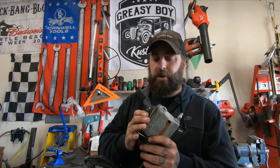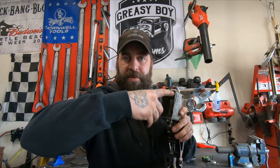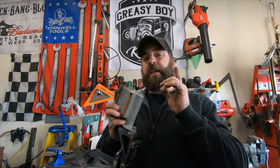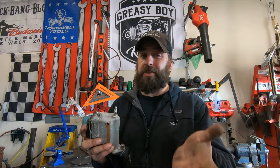This is a single bowl master cylinder — this is old style. What they mean by single bowl is there is only one cavity in here. You look at your car at home, it's probably got a divider in the middle; that's a dual bowl. This is a single. Old technology but compact, easy to use, and works in a bunch of different applications. The downside though: you blow a brake line off, all your fluid's going out. There's no divider — you don't have just your front or just your back, all of it's gone. Hit your brake pedal, goes to the floor, nobody's home. Bad things happen. I've been there, it's kind of scary. But you still use them all the time and they do work.